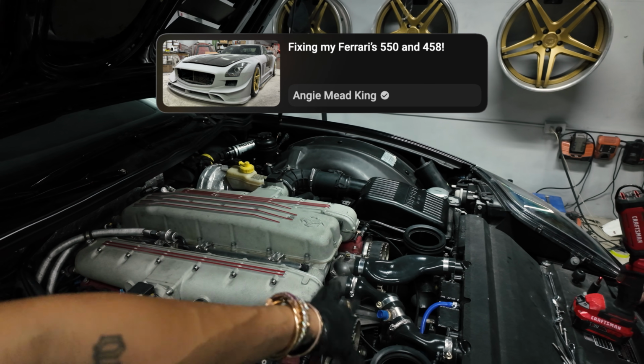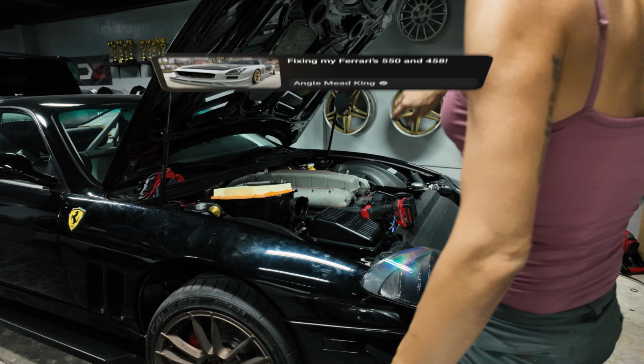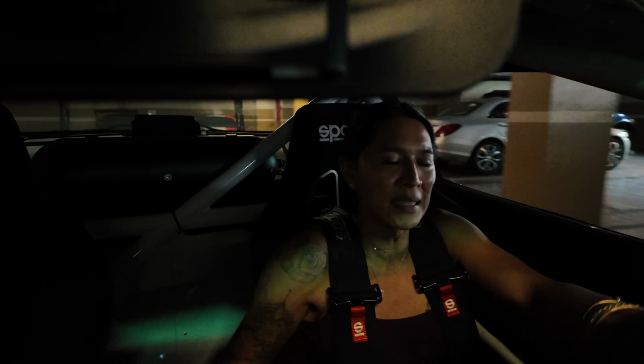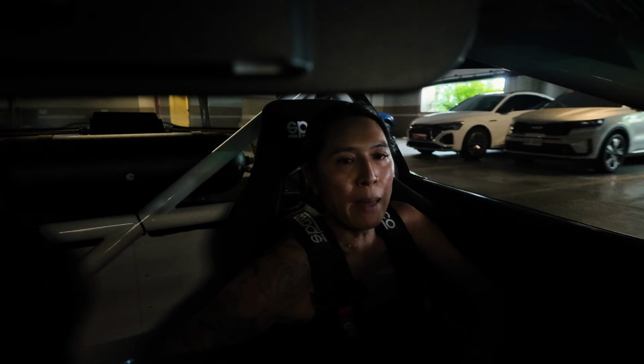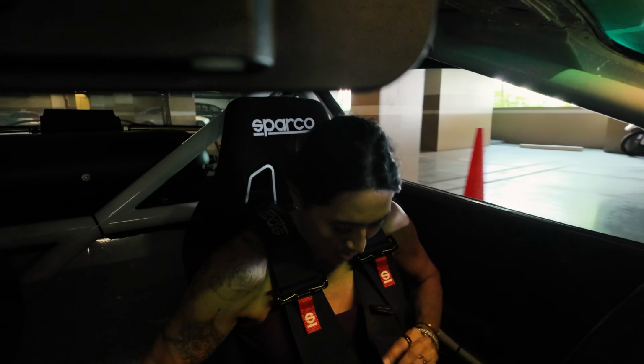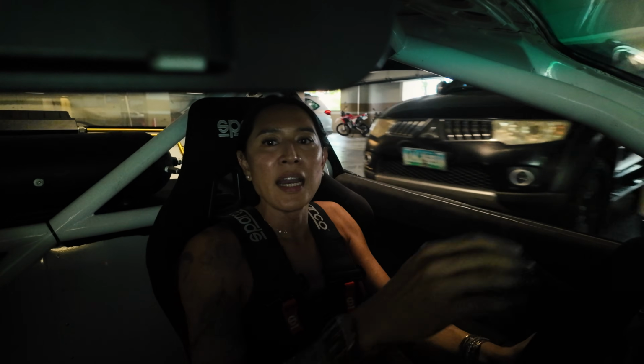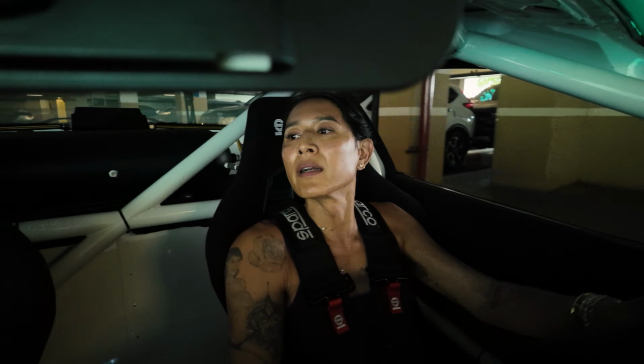From the last video, we updated so many things, but still I have to replace the radiator system, and I'm gonna go with a brushless fan system. So not happy in traffic, especially after coming in from the highway. When you park the car, it's going to come in hot, and it's very hard to cool the car from there.